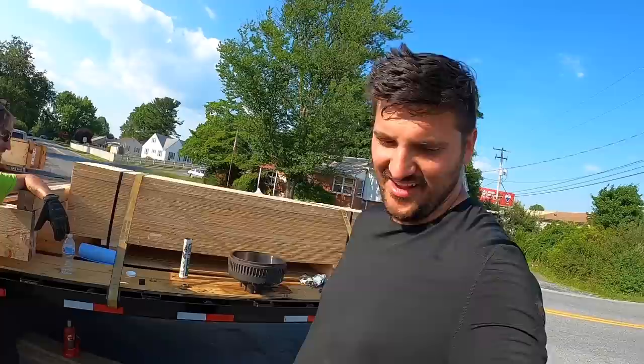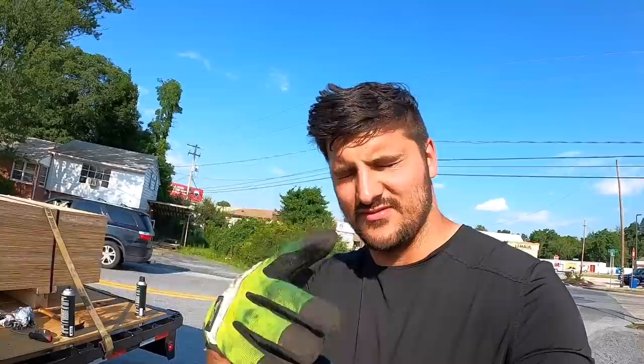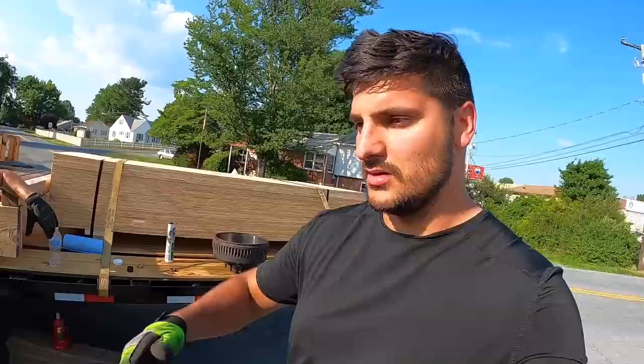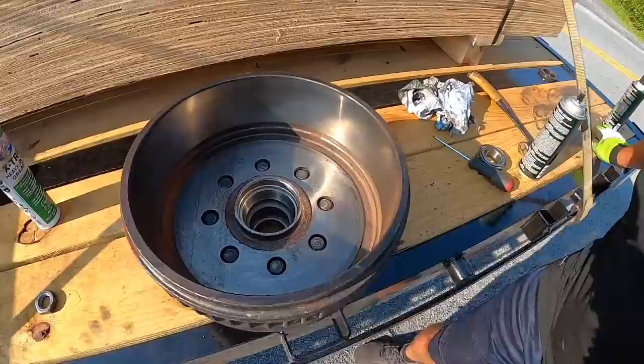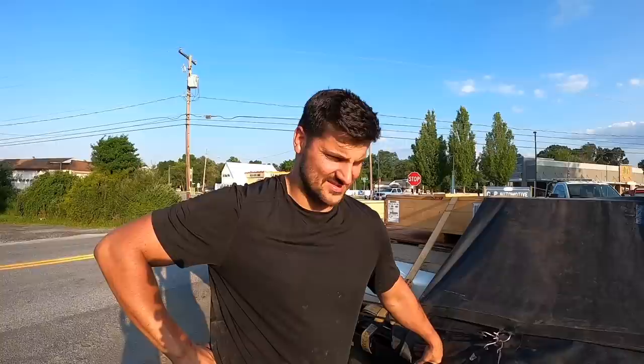I'm loaded up — got a nice load. I'm hanging out with CP Steve, who's fixing my old trailer. As I mentioned a few minutes ago, I'm switching from oil bath to grease right now. It's super simple: you take the wheel off, take the drum off, pop out the seal, let the oil drain, stuff it with grease, and that's it. I'm already on my second wheel.